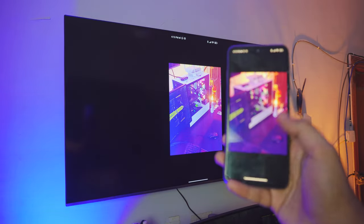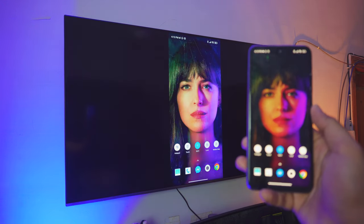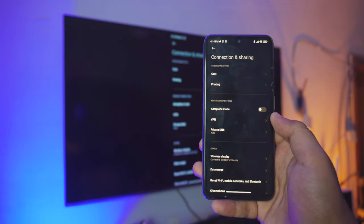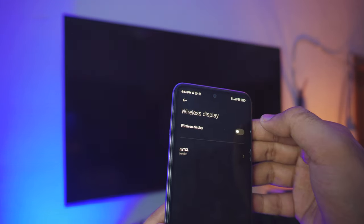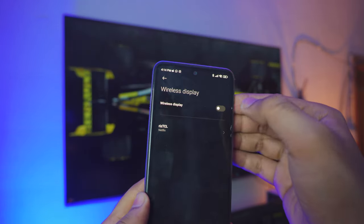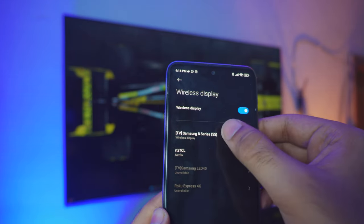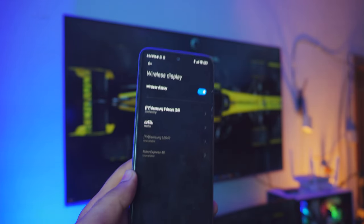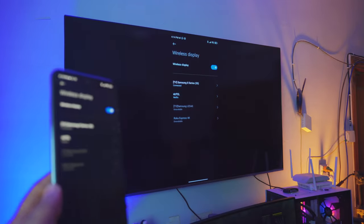It's pretty amazing. If you want to stop this, it's really simple as well — go back to the connection and sharing settings, go to the wireless display again, click on the display option and then the disable option. That's pretty much all you have to do. And if you want to do this again, just click enable on the wireless display — it should automatically scan the TV, click on your TV, and it should automatically connect your Android phone to your TV. It's working in the background — really simple, really easy, and we are connected.